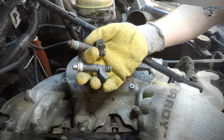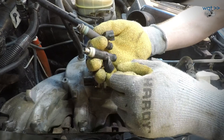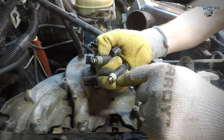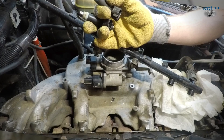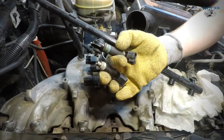This here's a pretty good illustration of what happens at the number three cylinder — why it has problems with heating and vapor lock. This is the only one that didn't pull its o-ring; it got stuck in there. It's also different from the others — I think maybe it's been replaced. Going to need to get that little gasket out of there, clean out these ports, and get a new injector o-ring set.